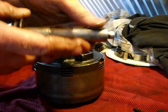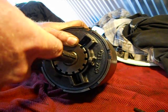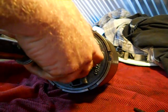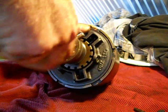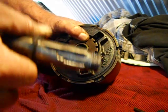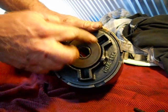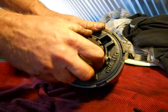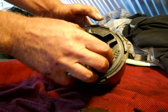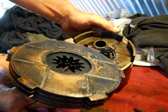These are keys that would hold that tail shaft in what I think is called the propeller gear — it would go further in than that. You get this out. I'm going to have to replace my tail shaft — you can see it looks pretty crappy. Then you remove the forward adjusting screw collar and you can just remove all the clutch plates.